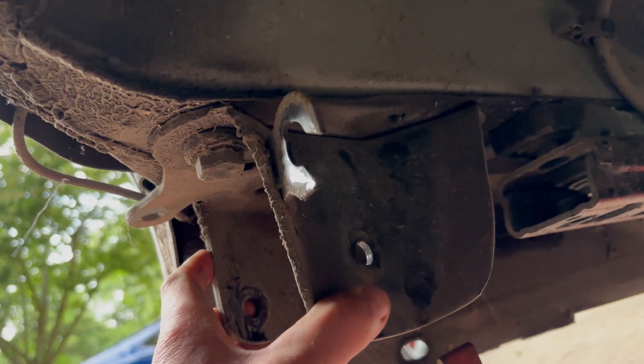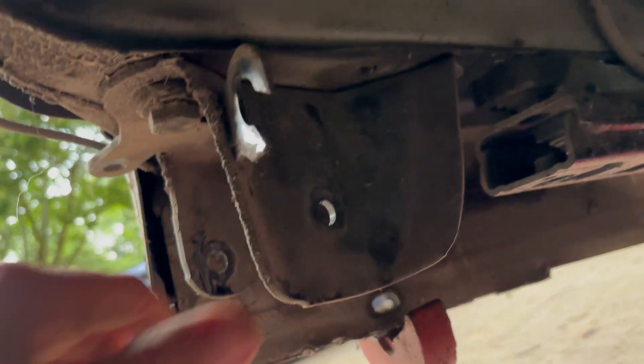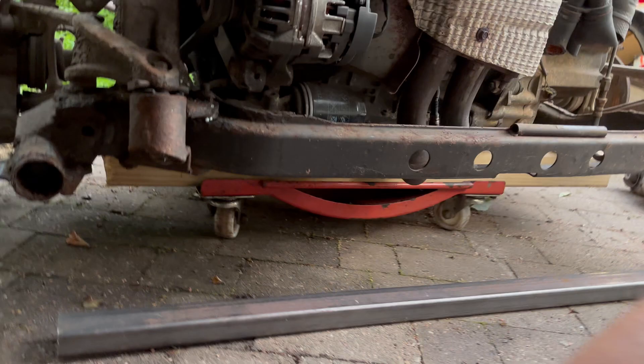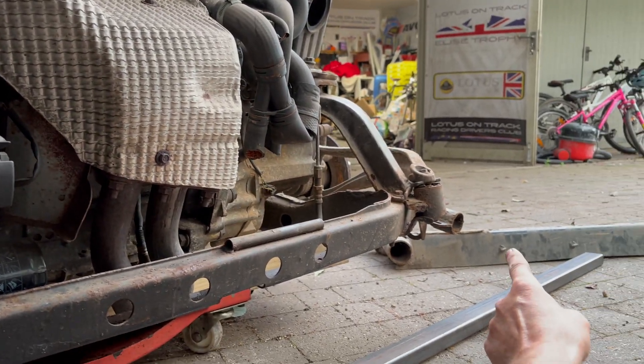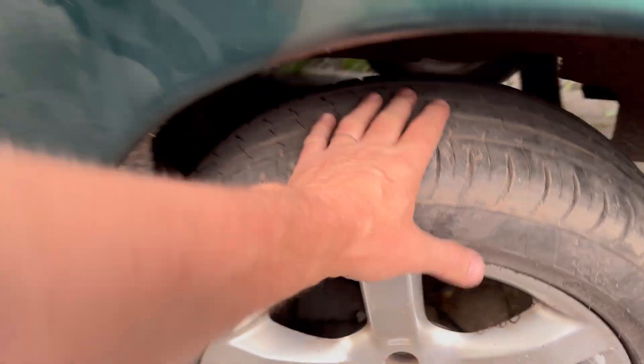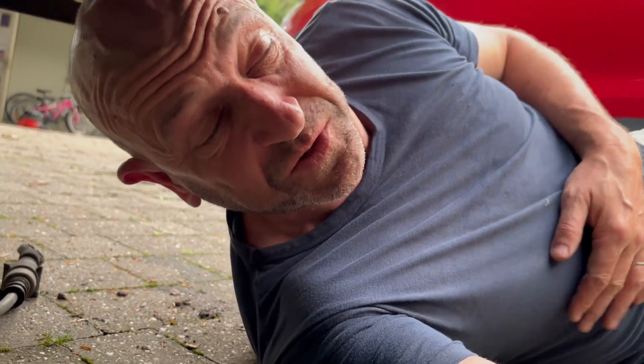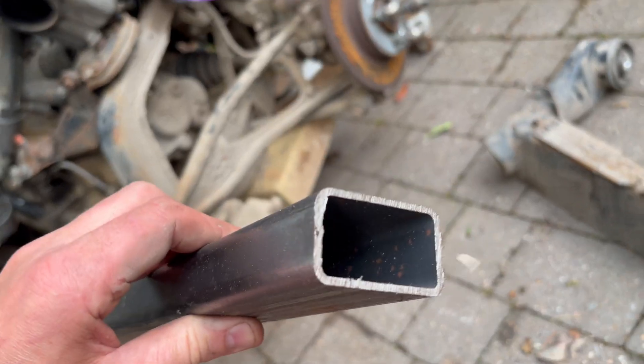Because when I take this bracket off, I think I've got a nice flat surface just here. I reckon what we can do is build ourselves a little mounting point. The really good news is the distance between this and this is pretty much the same as the distance between the Zoe's mounting points. So my little MGF - just remove the rear end. This is the mount and you can see there's not much to it, basically - it's a couple of bits of box section, boxed in. I've got a bit of pretty chunky steel and I think that should do the job.